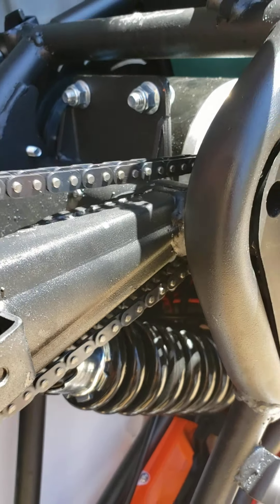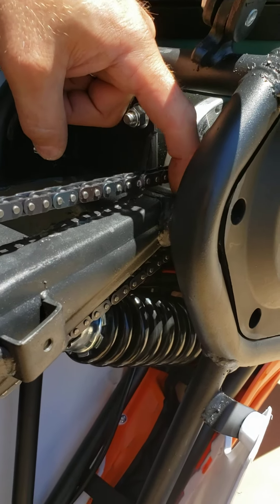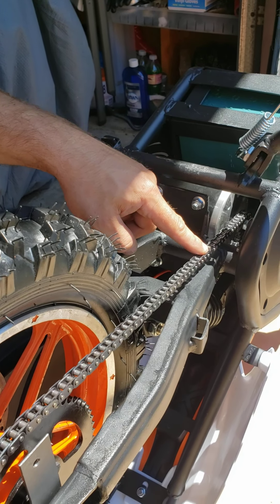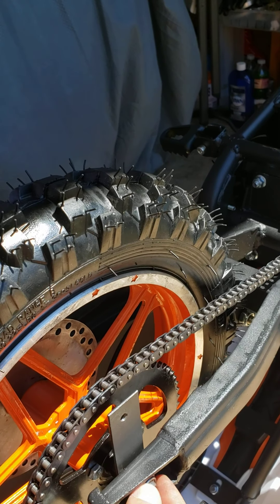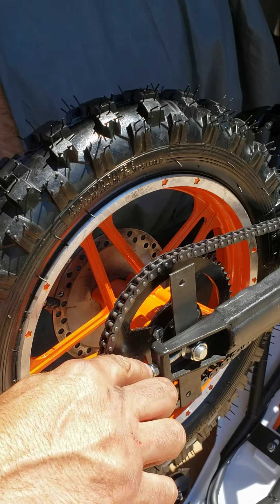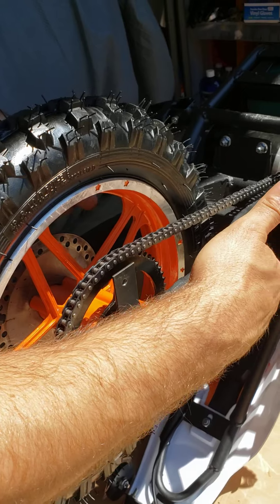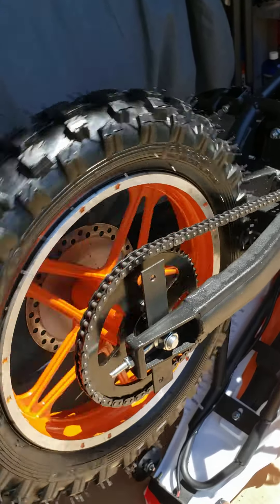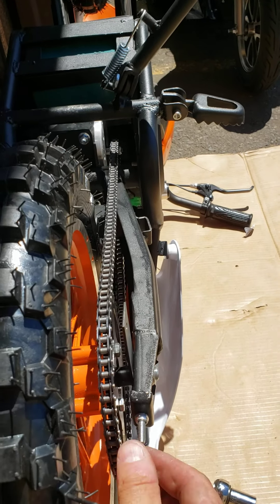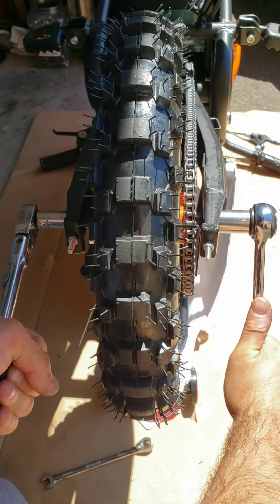That's how it's supposed to be — when you push it with your finger it should come back pretty fast. When the wheel is spinning freely, your chain should not touch this frame on the bottom or on the top. Make sure you adjust both tensioners equally on both sides; if you only do one side your wheel will sit crooked, too close to one fork or the other. This way it sits perfectly, your chain is not wobbly, not touching the tire, and not touching the frame.